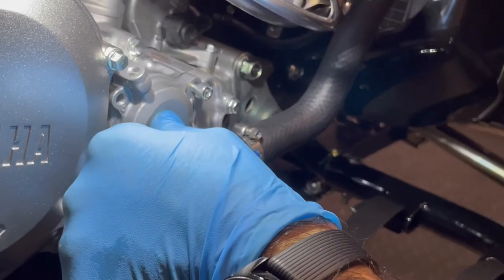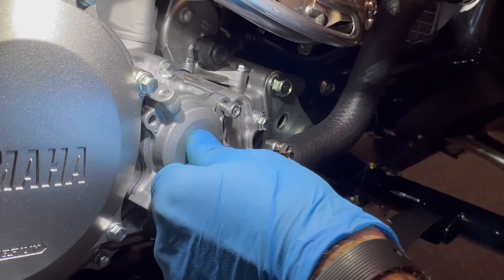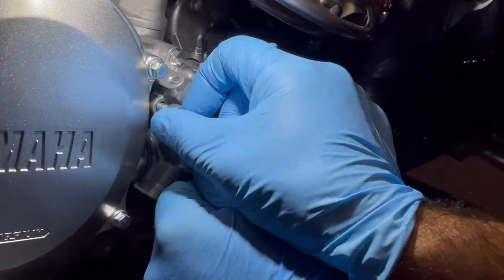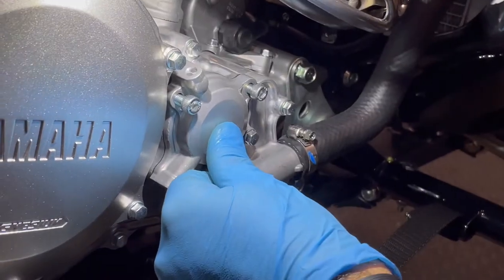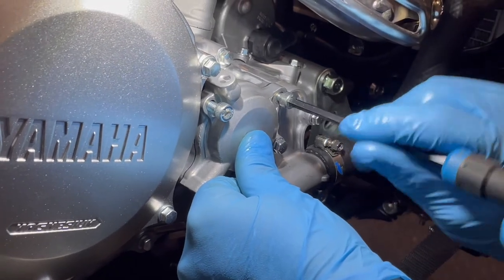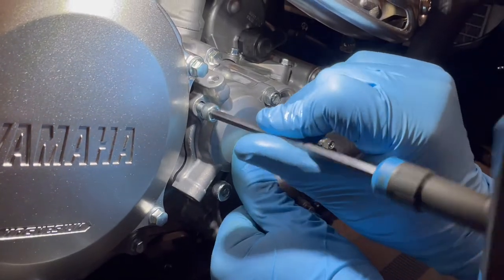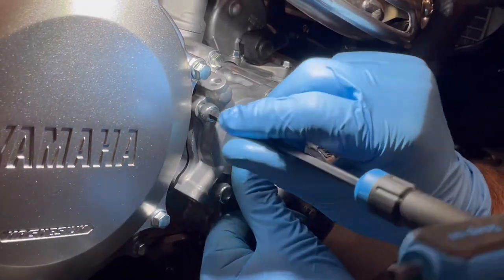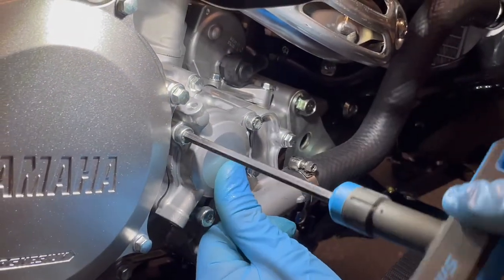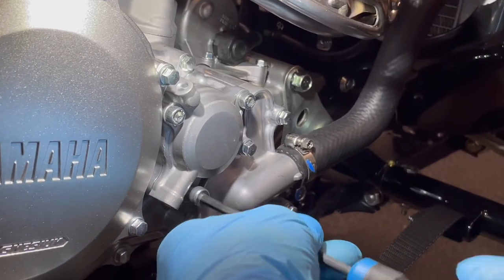It is worth having an extra set of O-rings. I have seen those leak, not when you're here in your garage or in your shop, but when you go to ride and then you start getting a boot full of oil, and there's nothing worse than that. The thing starts to throw oil at you and you're slipping on the brake pedal. It's literally dripping right there on your foot. I've experienced it. Now I carry the extra O-rings in my bag when we go traveling.